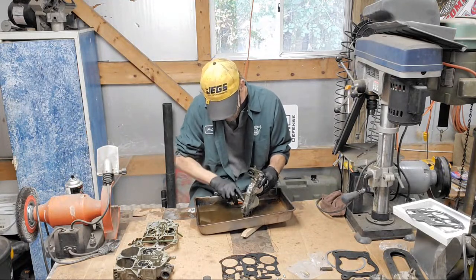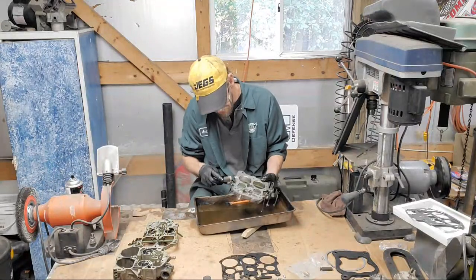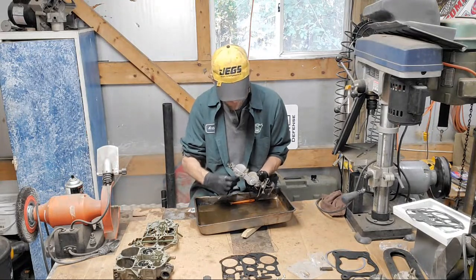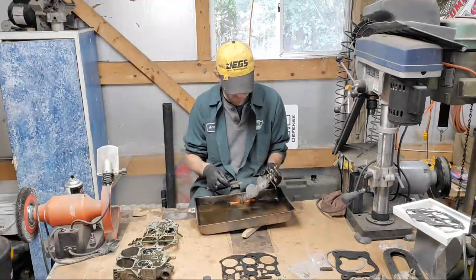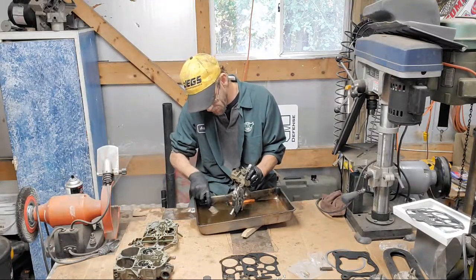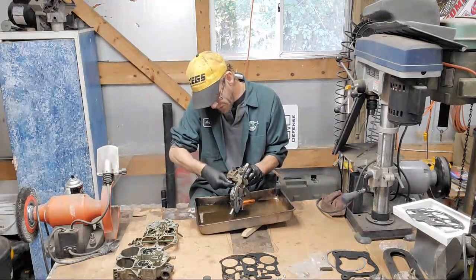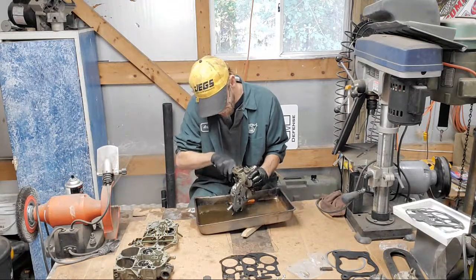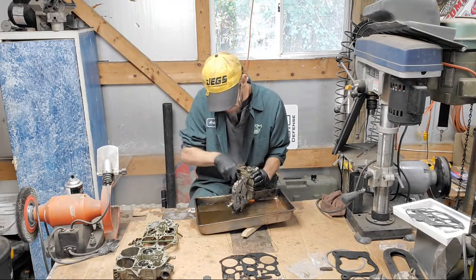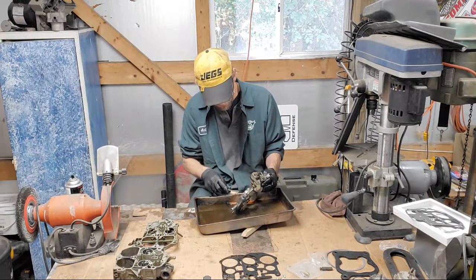But if you can work a quadrajet and you know what you're doing, you can make a quadrajet sing. And they actually are a pretty good carburetor. But like I said, you got to get them at least an inch and a half off the top of the intake, away from the motor. You've got to be able to disperse the heat off of it and keep that carburetor cool. I would say not let the carburetor get above 100 degrees.